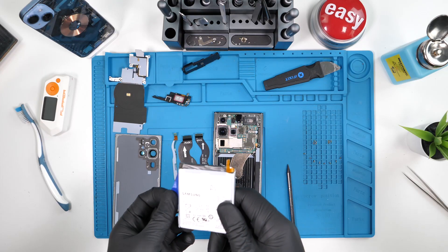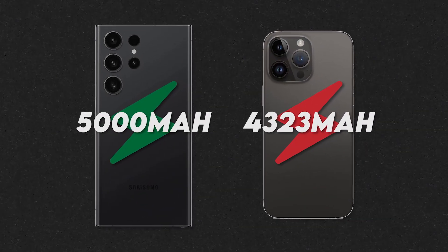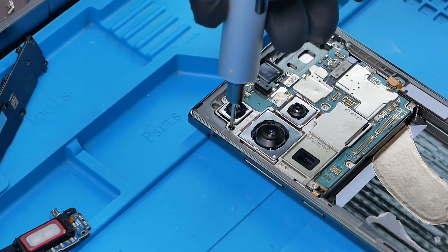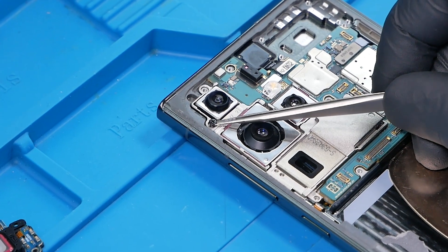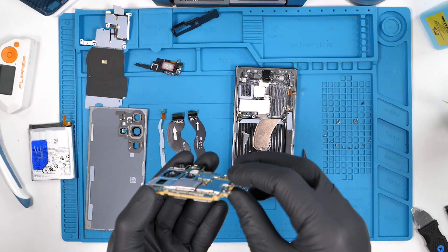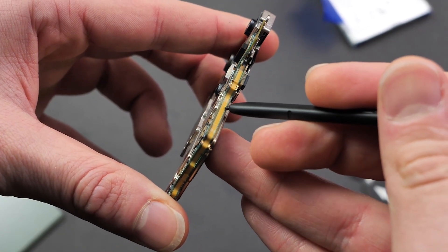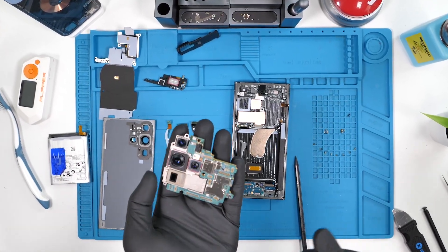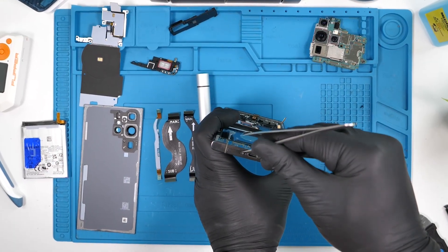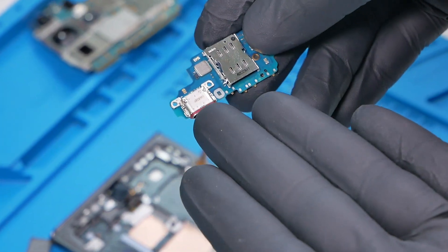The Samsung Galaxy Ultra battery has 5,000 milliamp hours, compared to the iPhone 14 Pro Max's 4,323 milliamp hours. We'll unscrew that one black screw — repair-friendly by making the one screw not covered by brackets black so it's easy to identify. We'll disconnect the front camera and remove the main motherboard. This motherboard, like most smartphones right now, is a sandwich board — two layers pressed together via solder joints, allowing manufacturers to fit more components into a smaller space. We'll also remove the sub board, which has the USB-C port and the SIM card reader.